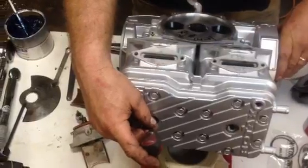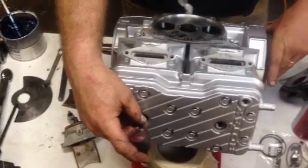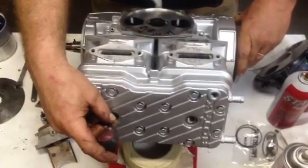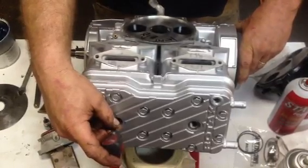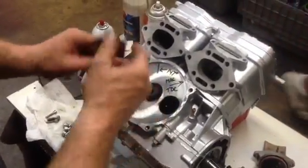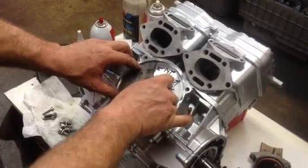I'm going to move it a little bit - it's going down, coming up, going down. Right there is top dead center. Notice there's like a sweet spot where the piston isn't moving up or down. You want to find the halfway point in that little spot. So that's top dead center. We'll take our disc - the disc is asymmetrical, meaning it can be turned over either direction. This one goes this way, and notice how it lines right up with my 147-degree mark. That's the way it should go.